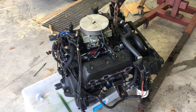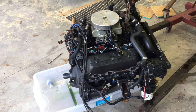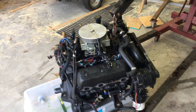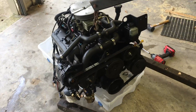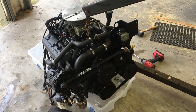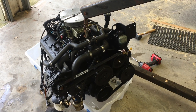There are two wires on the starter — I'll take a photograph to show which wire goes where. The battery cable has already been taken off the hot post. Then I'll unbolt the starter and move it out of the way. After that, I'll move to the front, loosen the idler pulley first to take tension off the belt, remove the belt, and then start taking off the accessories from the front of the motor.